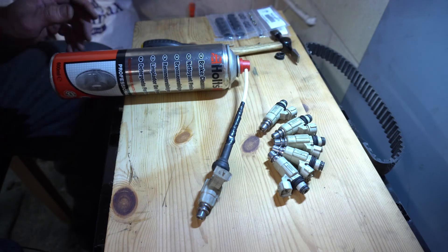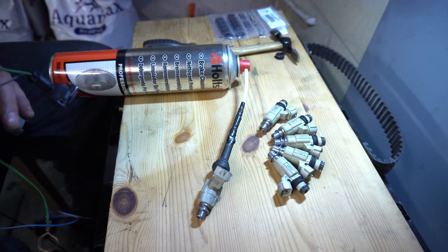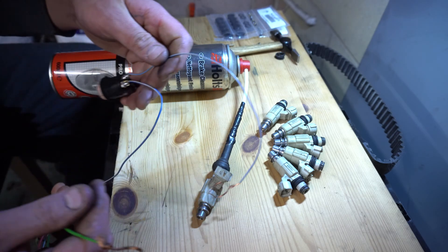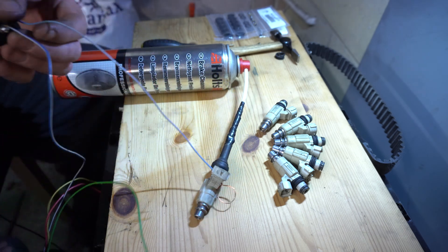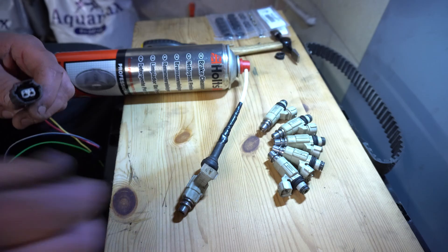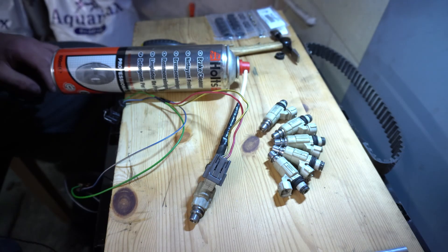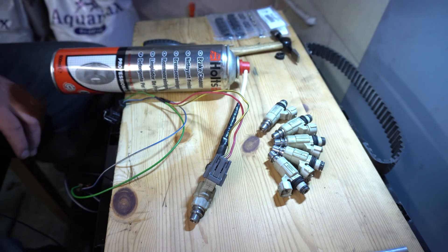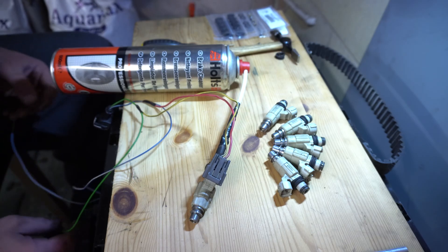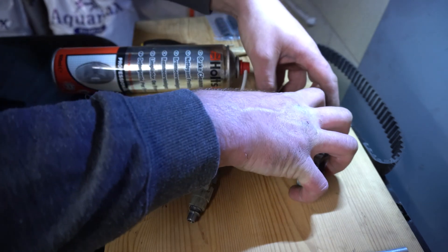I need to power up the injector. I've got this little tool with two injector wiring connectors — I have a ground here and a positive here. The positive is connected in series to a little non-latching switch, which is then connected to the positive side of the fuel injector terminal, and the negative just goes straight to the negative of the battery. This is just robbed off another FTO. I've got a car battery down here but it's half discharged so it's running at about nine volts. I'm going to connect positive to positive, negative to negative, and you should be able to hear the injector click.